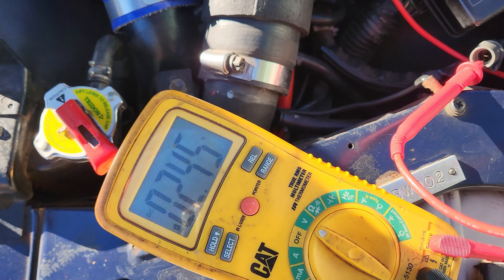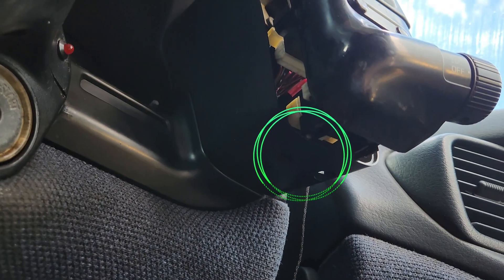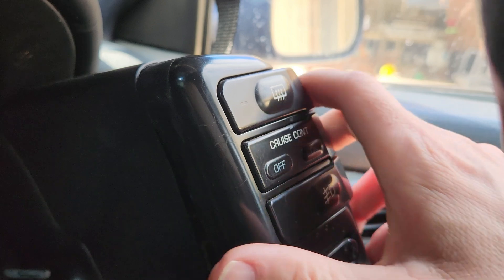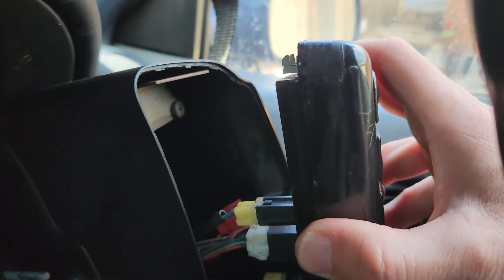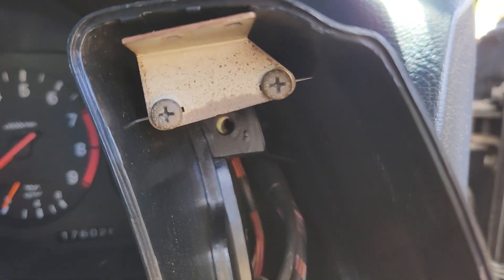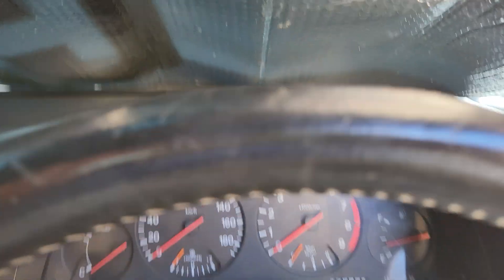If that voltage is all okay, our next step is to get to the gauge cluster and the tachometer itself. We need to take these two control pods out the side of the dash in order to get to the cluster. There are bolts underneath two of them and they hook in at the top where we can unplug all of the plugs and take the two gauge pod controls left and right out and away from the dash. Next we can take the left and right pods out — there is a bolt at the top and two at the bottom. Take them out and remove the pods so we can get to the rest of the dash.